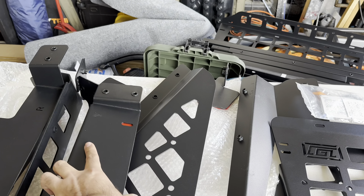Using the trim piece remover tool they provided, we're going to take these off so we can unbolt them — we're going to reuse them to mount the panel. We're also going to take off this trim piece here and this piece here. Once you do that, there's a 10mm bolt — you take off the plastic. Also a 10mm bolt on this one, and this one you just twist and pull and it comes out.